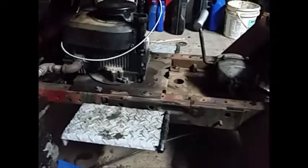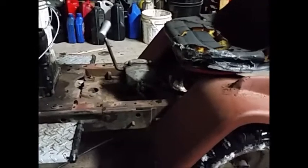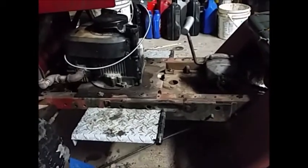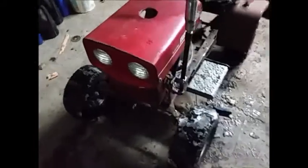So I put a slightly bigger pulley on the engine and a slightly smaller one on the transmission. I wouldn't think it would make that big of a difference. I thought it would have just sped it up a little, but not to the point that it would kill the engine. Also, some carnage. My brake pedal bolt undid itself. It fell out, and it bent the linkage all to everything, so that's got to be redone. Well, there she is. So, until next time, thanks for watching.